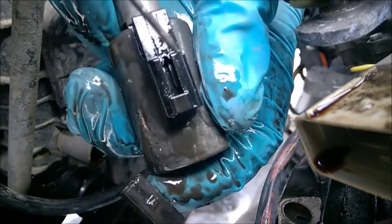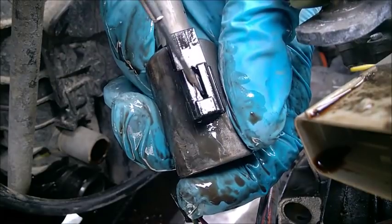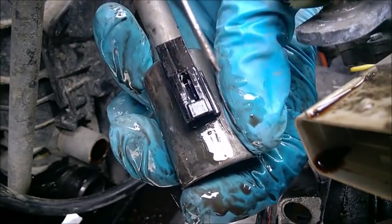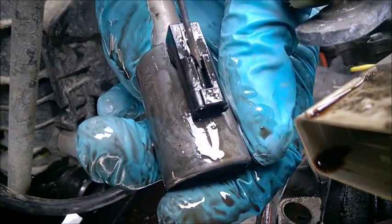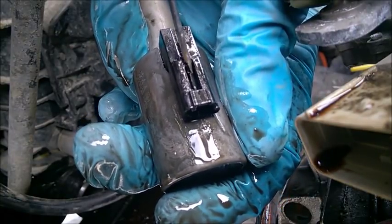Again, you see the two connectors are in there, the two metal parts, that's why you insert the screwdriver in between. Be very careful not to bend them, that's very important. Have the Rostra solenoid at the left and the Volvo one on the right side. These are the blue ones. Notice that if you put the connectors on the same side, the channels are not on the same side. That's why the Rostra instructions say to place all the solenoids with the connectors upwards.